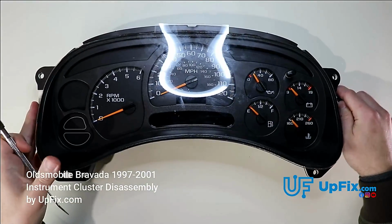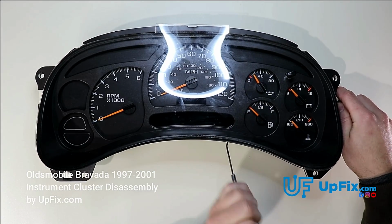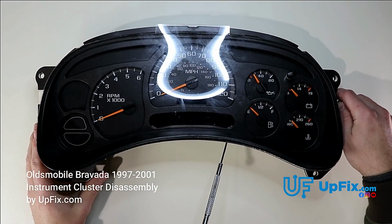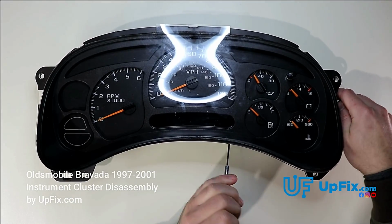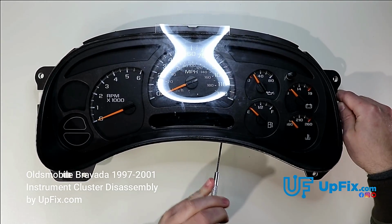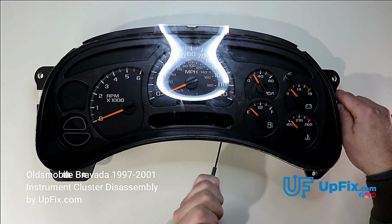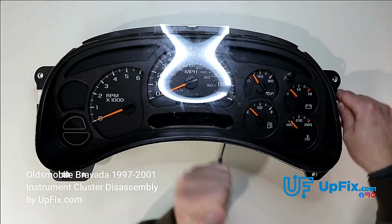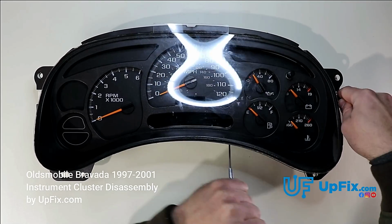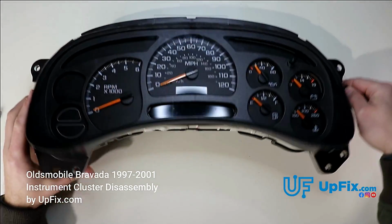As I'm prying the board up, I'm going to insert the clip inside here. And now I'm inside on one corner. And basically, you're just massaging it out. If it doesn't come out right away, try the other side. Try not to stab it too much, because the more you stab it, the more it might drive itself in there and it won't come out. So basically I got one tab freed up, and let me show you what that tab looks like.